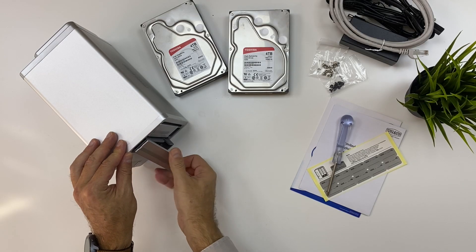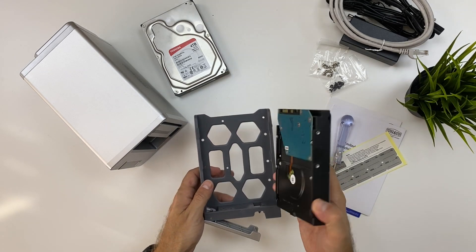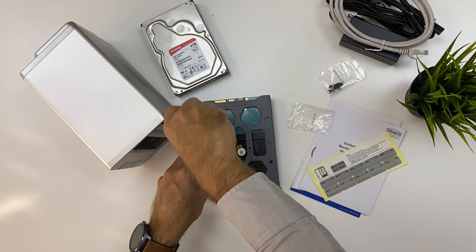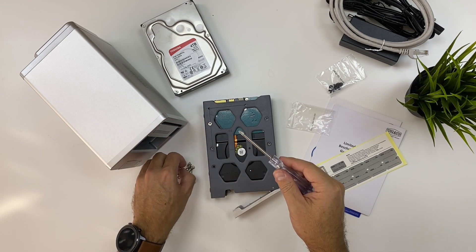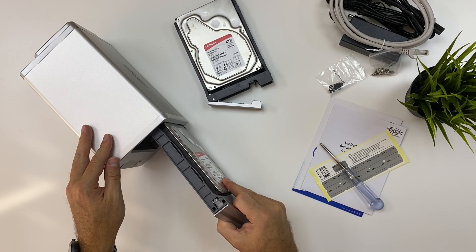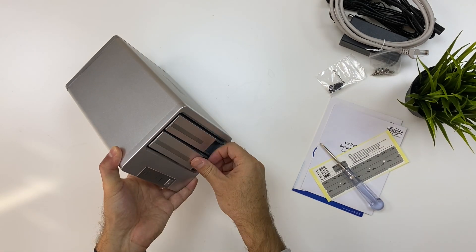In terms of setup, for those who've never worked with a device like this — very easy. All we need to do is open these two front bays, insert the hard drives. Keep in mind to use hard drives dedicated to NAS solutions — I use the Toshiba N300 and I'm really happy with it; I've also used the WD Red. These are the discs I usually recommend because they make a huge difference over desktop drives. Disc installation uses screws, which isn't my favorite method, but TerraMaster is still using this setup.